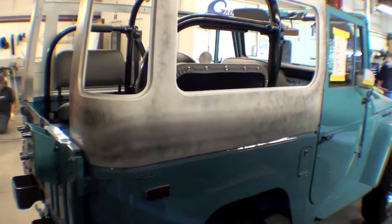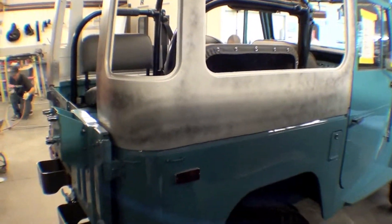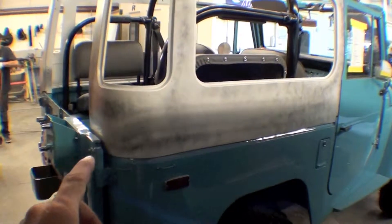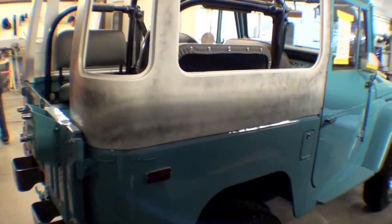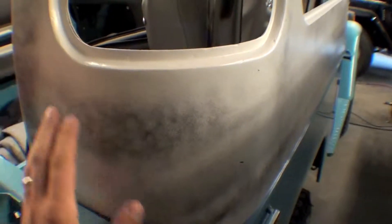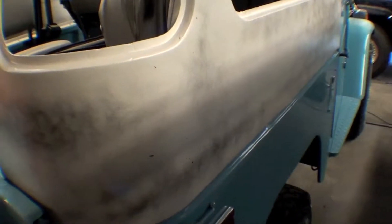This is another one of those scenarios where you're not quick enough and stuff goes into the booth. Body work was completed the other day, and yesterday this went into a primer sealer. The primer sealer is typically grey, but you can see a slight black in here — they put a little bit of spray over it because it's going to be wet sanded out.